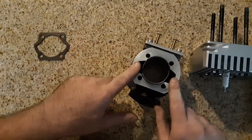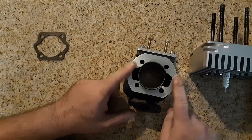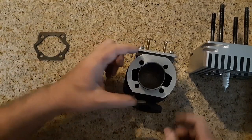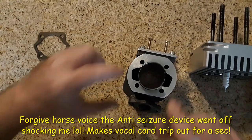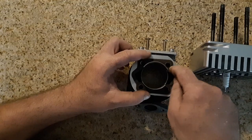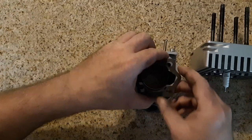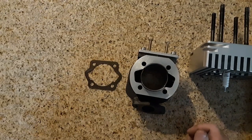As far as the bottoms go, when I make these — and I have a video on this too — this is not rocket science. I buy a 90 millimeter piece of cutoff stock: 10 millimeter thick for 40 millimeter cranks, 8 millimeter thick for 38 millimeter cranks. You go on eBay and buy a round 90 millimeter piece of round stock — that's the actual height you want. All you do is take your gasket, put it on, trace the pattern, dremel it out, then take the gasket for the Minarelli other side, dremel it out, and just blend the two together. If you just want to buy the spacer itself, that's like 20 to 30 bucks online from one of the places that sell them.